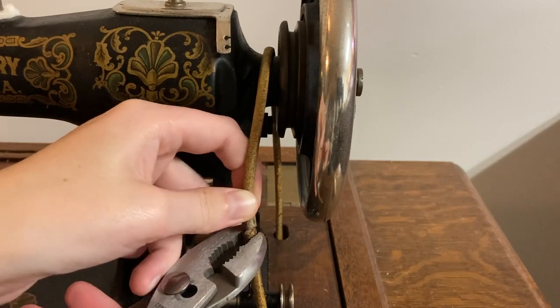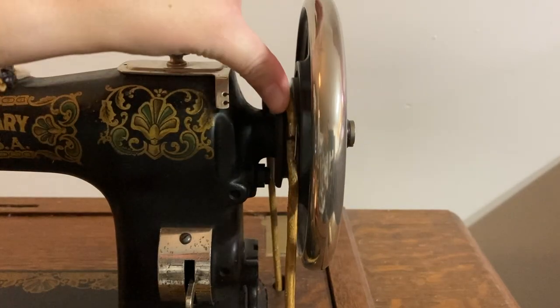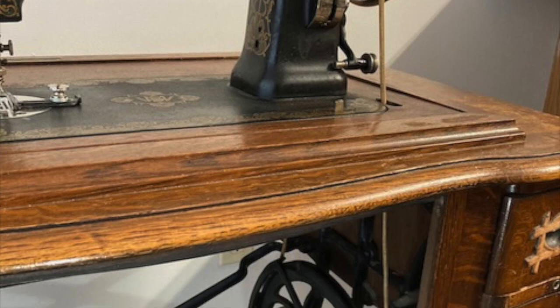Do the punching with the belt out of the hand wheel groove — this gives you more slack to get the staple into the ends and squeeze it closed. To get the belt into the hand wheel groove after the ends are connected, press the belt towards the groove and turn the hand wheel. The belt will pop right into the groove. Your belt is installed.